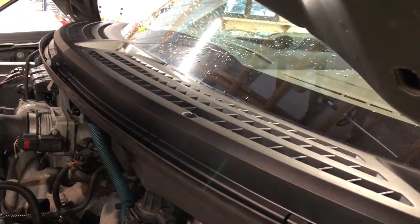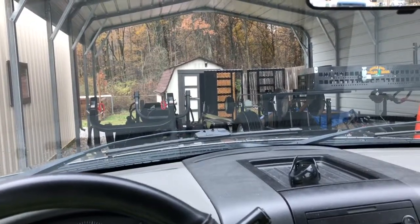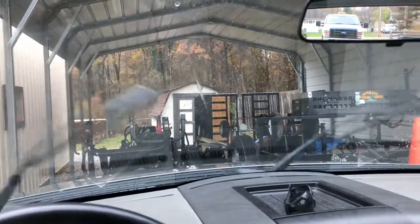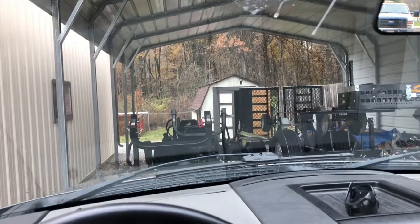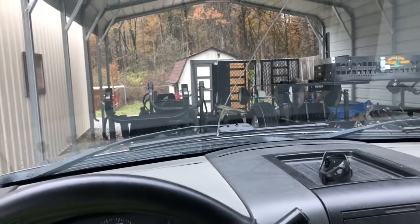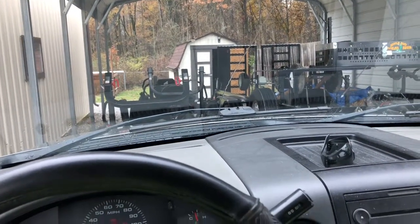Make sure your wiper fluid works and there's no leakage out of those. Once you've got that done, you've replaced them and you've got a better looking truck. This is a cowl replacement on a 2005 Ford F-150. Let's make sure the windshield wipers are working and that the washer fluid comes out evenly - yep, both are working. That's how you replace the cowl. Don't forget to make sure your windshield wipers are on the same side that you took them off, and don't forget the weather stripping.